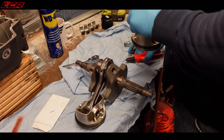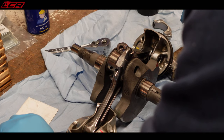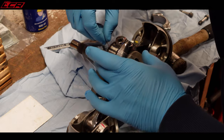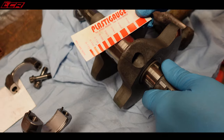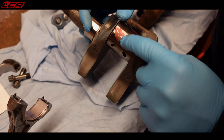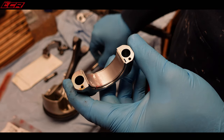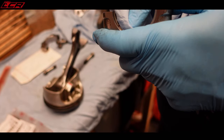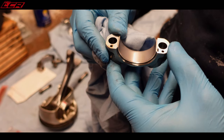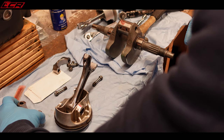You don't want to mess the plastigauge - it's sat against the surfaces. The reason I'm doing this again is because it didn't have a uniform size - I think I moved it while we were torquing it down. But it's nice and flat there this time. So I did definitely squish and move it last time. We're right at the bottom of the range that I was given, so we are at the tightest clearance, but that's good news. We're using blue-blue bearings - that's what we've got, so we're using them. Be really gentle getting the plastigauge off - you don't want to apply much force because you don't want to score the surface at all. Just nice and gently rub it off. That's the reason behind putting a little bit of oil in there first to make it easy to come off. You can do plastigauge dry but it's advisable not to.